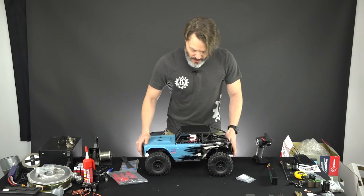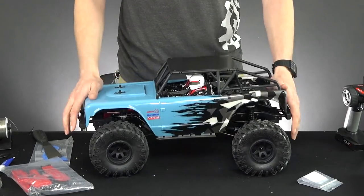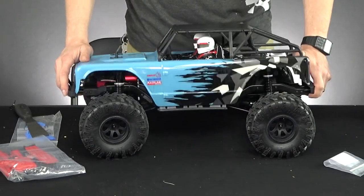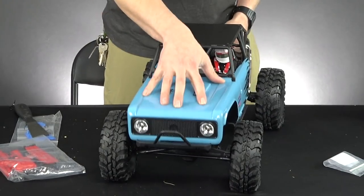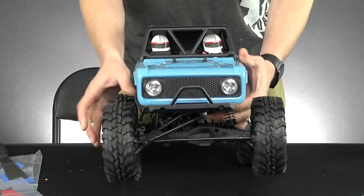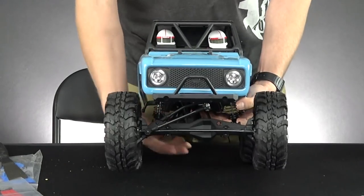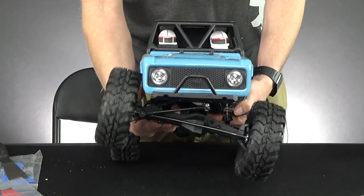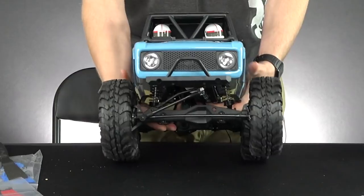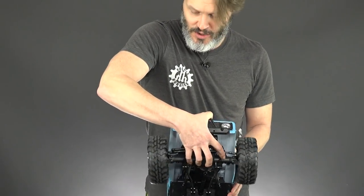Let's just take a look at this rig here. A little suspension travel shows me that the wheelbase does change, but we're going to notice that when we're actually rocking it. A little bit of body roll shows us that we do, in fact, have just a little bit of bump steer. Not much bump steer on this side, but on the pan-hard mount side there's a little bit. So not quite a perfect steering geometry, but considering that it is a chassis-mounted setup with long travel, that's not too bad.